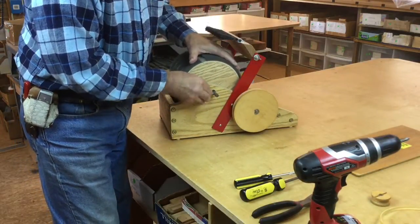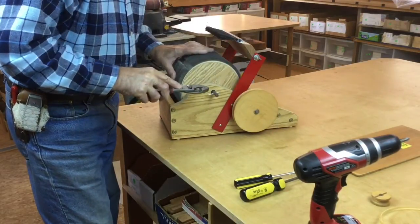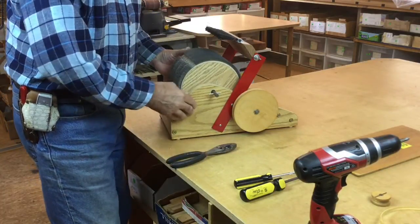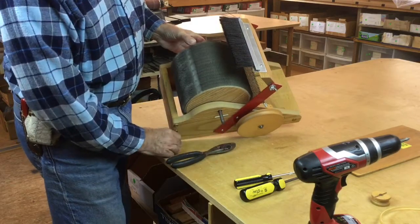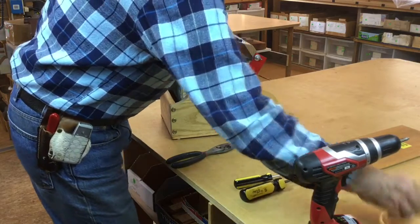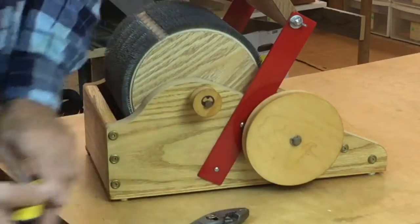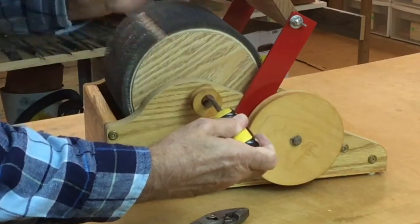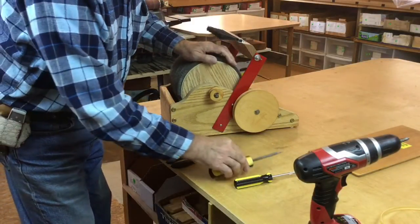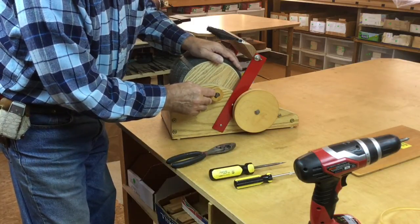The second technique is, or another technique, put your pin back. Sometimes it's hard to get in, so just tap it. And tap it so that it's evenly spaced. Put the small pulley back on the groove. Your E-ring, make sure it's on the groove. You can use your flat blade screwdriver to just push it down like that. Takes a little practice, but you can do it. Just be careful when you're doing it that you don't lose the ring.